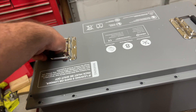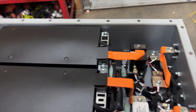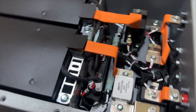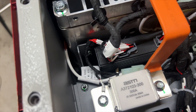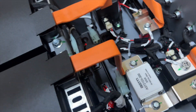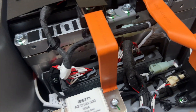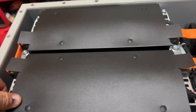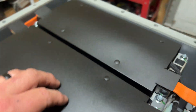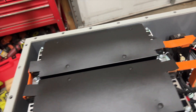We got all the bolts removed. Let's go ahead and remove the top and see exactly what's inside. It looks like a battery we've previously had on the channel with these covers, but down here looks a little different. We have a 300 amp fuse there, looks like some relays, a built-in shunt down there — that looks pretty good. Looks like another relay there as well. Everything's nice and neat. Looks like the BMS is down there with those wires going into the side. The covers have plastic clips so we're going to leave them. Eight cells, eight cells — in series for 16. This looks pretty good.